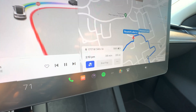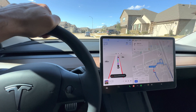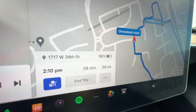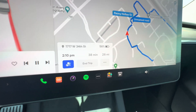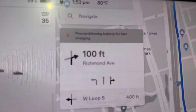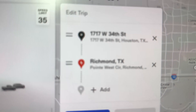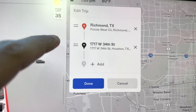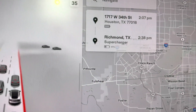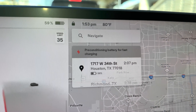It is on full self-driving. If you are enjoying my content, make sure to hit the like and subscribe to the channel because there's a lot of Tesla content coming. Why I'm going to this EV Go — it's a non-Tesla charger about 38 minutes from my home. I'll reach there with around 55-56% charge. One thing I noticed: when I put the address for that station, it was not showing up in Tesla's listed charging list, so I had to add a Tesla supercharger address just to start preconditioning my battery. If I hadn't done that, my battery wouldn't have been conditioned — that's why you'll see the Tesla was charging at 75 kilowatts instead of 100. Now enjoy the experience, and this is the whole experience in real time — this is the voiceover — but now let's begin the video.